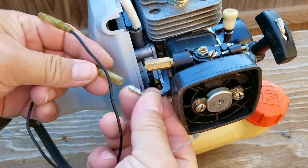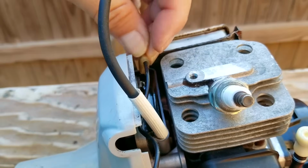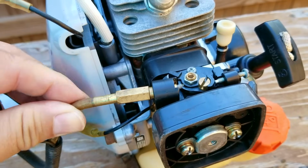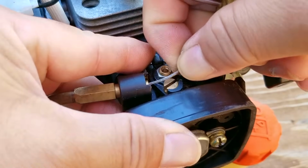Those were also the two main causes that were mentioned in the comments, so changing the coil is the only thing that makes sense. We know the compression is good, but we haven't been able to make a call about the carb just yet. However, even without the carb, the engine should have been able to run for longer than a half a second.